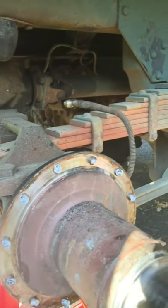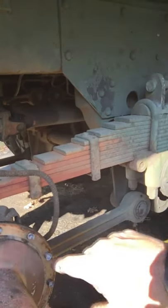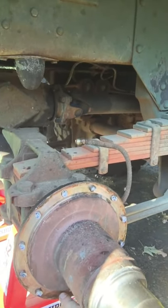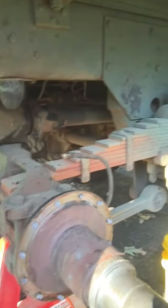Not all of these rivets you'll have to drill out and knock out — you can go ahead and keep some of them in place. Specifically, you're going to have to knock these two out because that's where your upper mount plate is going to go for your caliper. But these, all the way around until about your 6:30 to 7 o'clock position, you can just grind those right down and just leave them in place — they're not hurting anything.